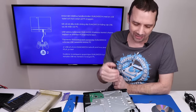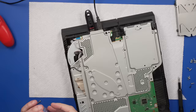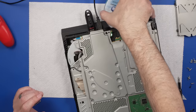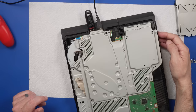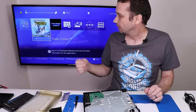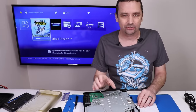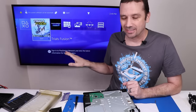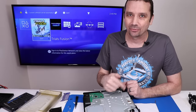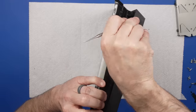We've got to get this thing taken apart and give it a really good cleaning — I'm guessing the thermal paste is probably pretty bad on this one. Before I turn it off, let's check the disc drive. It looks like it reads the disc just fine. I'm going to take the disc drive apart and clean the laser and the rollers too — I feel like they're probably pretty gross. Just sitting at the dashboard, I can already hear the fan starting to ramp up again, so this definitely has an overheating problem we need to address.